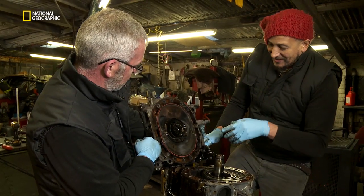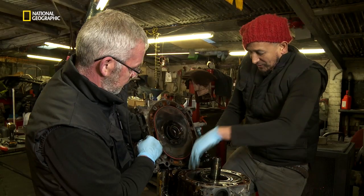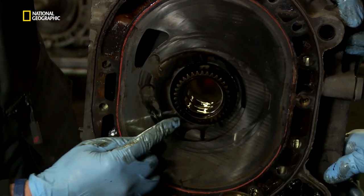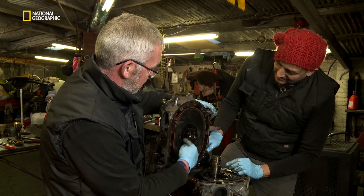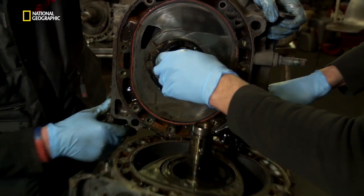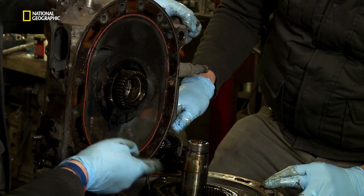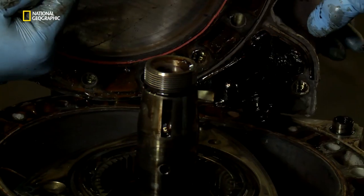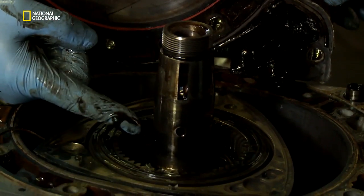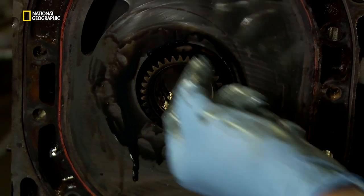Those seals, once they compress, keep all the coolant away. On this face is essentially all the combustion chambers, where you've got the phasing gear. The rotor rotates on the phasing gear — this is stationary. There are two stationary phasing gears as we call them. As you can see there's a bearing inside the phasing gear which the shaft runs on, and you can clearly see by the markings — that's just a plain bearing.